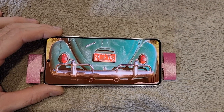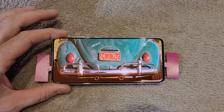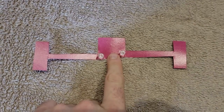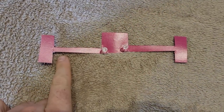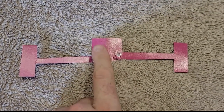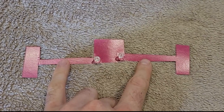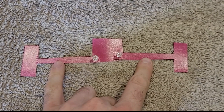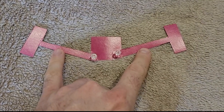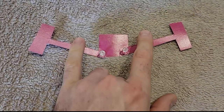Here's my Beetle, and for this example, those pink things are my tires. So if we take the car away, these are my tires, this is my transmission, and these are my axle tubes. The wheels don't pivot on the axles — the axles pivot on the transaxle. So in my pretty pink little world here, if you can imagine this was real, when you lower the car, you're going to change your camber angle and make it all like that.